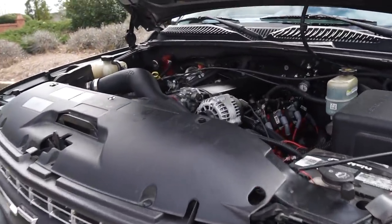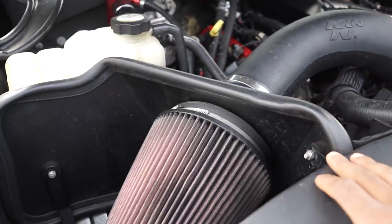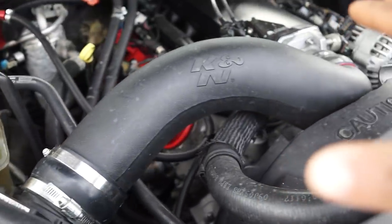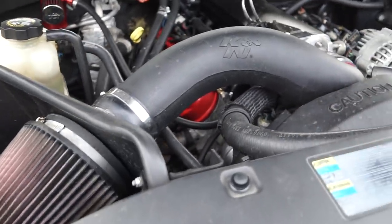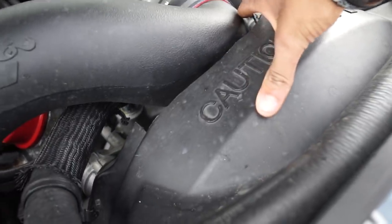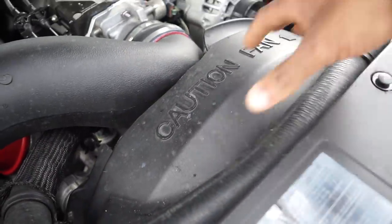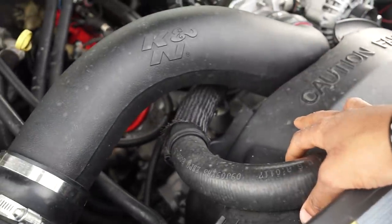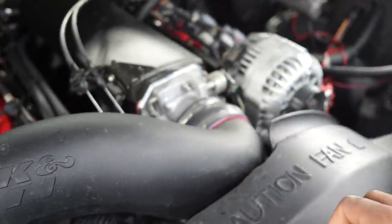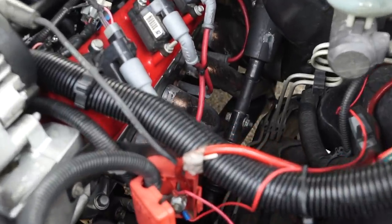Take that with a grain of salt. I've had the K&N cold air intake since pretty much when I got the truck — bought it soon after. My particular setup is probably a bit restrictive but it is what it is; I'm thinking about building another one later on. With this intake I had to cut the fan shroud. One upgrade I have not done yet is electric fans — if you're going to do this, do the electric fans. They make direct swap kits for this. I had to cut the shroud and even cut the fan blades down — I don't highly advise that.